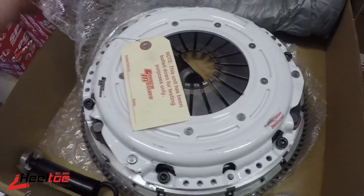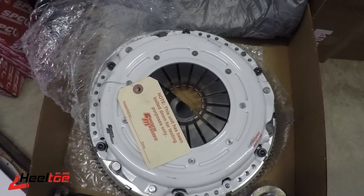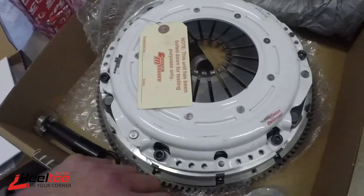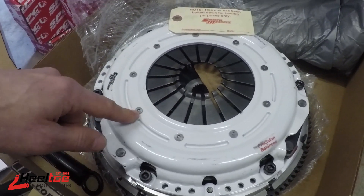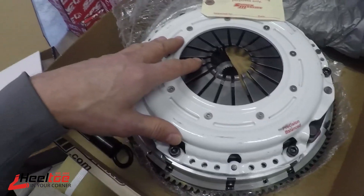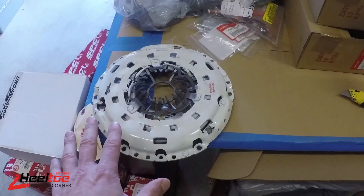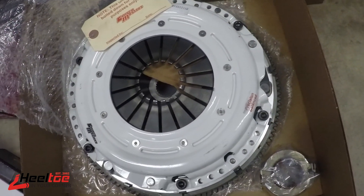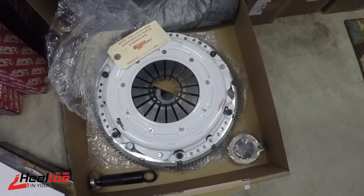So basically that's it — I just wanted to show you the difference between what a self-adjusting pressure plate looks like and a non-self-adjusting pressure plate. Hopefully that was informative. If you need either of these clutches, let us know. Other companies are also doing the non-self-adjusting style — Spec Clutch has gone to this style, Accelerate Performance is private-labeling through South Bend Clutch. South Bend has their own self-adjusting clutch but the Accelerate one is non-SAC. Most aftermarket clutches you find are going to be like this, except if you get an OE replacement it'll likely be the self-adjusting one — there's nothing really wrong with those on the whole, but for performance you're much better off with the non-self-adjusting. If you're unsure which one you're going to get, just hit up Heel Toe and we'll make sure you get exactly the best thing for your sports performance or OE replacement needs.